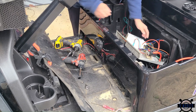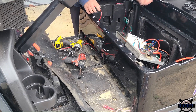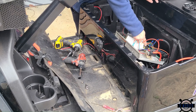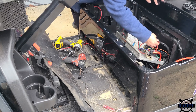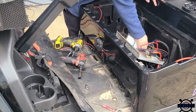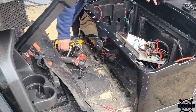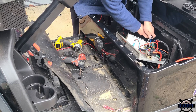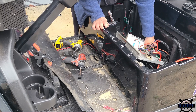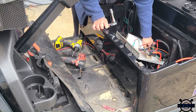Next, on this blue wire, it's just a little bullet connector — just pull it apart and you're good to go. That only leaves the one black wire, and this black wire goes to the B-negative terminal on the controller, which is just another half-inch bolt. Sometimes you've got to pop off the little plug on top just to gain some access — if you do that, make sure you plug it back in otherwise nothing will work. This is just a half-inch, 13 millimeter — pull this bolt out, take off just the charge wire but leave the other ground wire that's there, and put the bolt back in. Tighten it tight but not overkill.